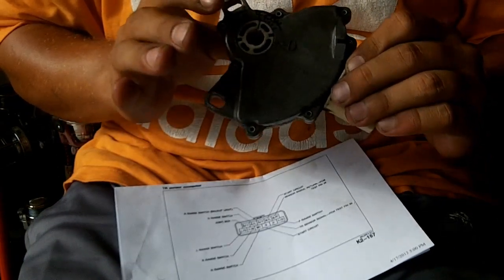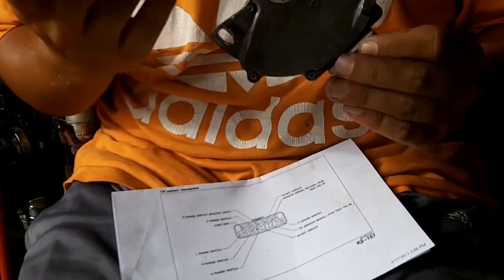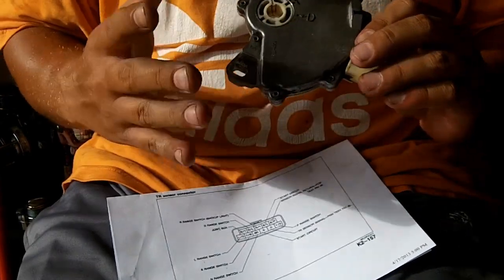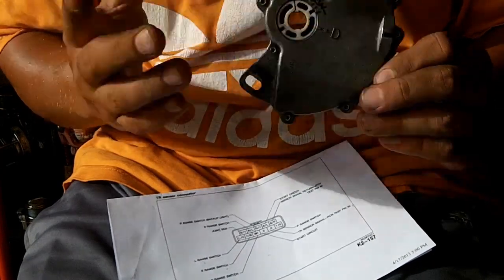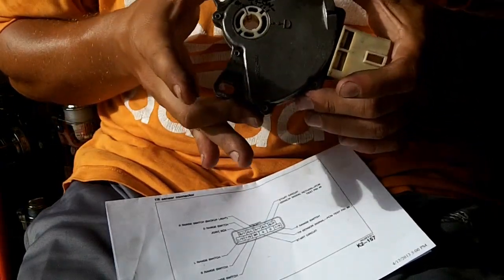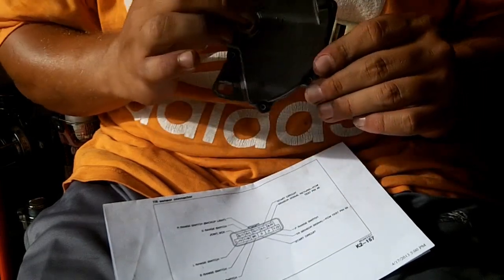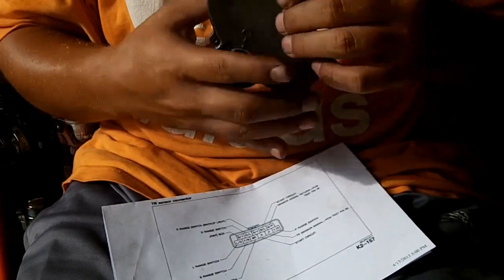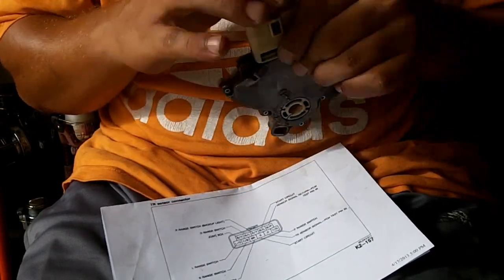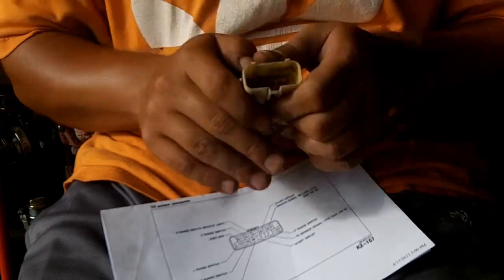I'm going to have to come up with my own switch because this is a mechanical switch, but I want to do this electrically or electronically. You can't do anything with that in the manual transmission. There is no shift cable in the manual transmission. The easiest way would just be to modify it electrically using some kind of switch circuit or relay. So that's my plan, to try and figure out a way to turn park and reverse here into a relay, because I thought this was all going to be electronically controlled. I thought, you know, you put so much resistance on one pin and it would open up the gear, and all of these would have continuity anyway. It would just be different resistance values. That would be so much easier to work with.